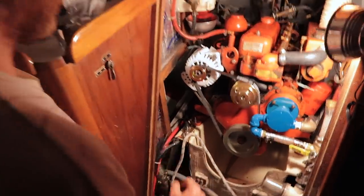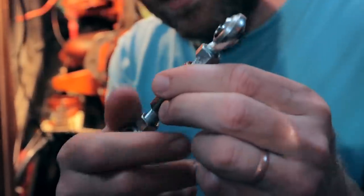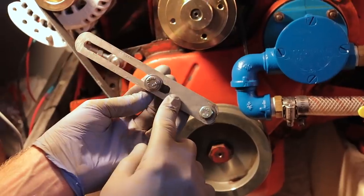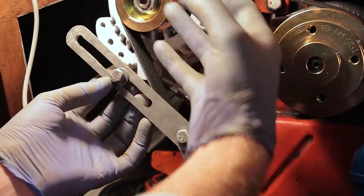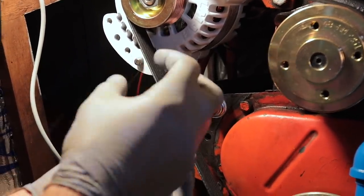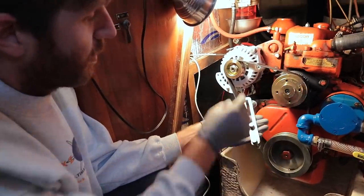Is that bracket gonna work? We're gonna use it for now, and then I'm gonna get a thing called a Heim connector, which actually works like a turnbuckle, where you can make it longer or shorter, so we can put tension onto the alternator and then thread these bolts down tight and lock it. This is the old-style alternator bracket. You could tension by pushing out the alternator and cranking this down, but it would invariably slip in a little bit and you'd need someone to help push against the alternator. Having this Heim connector is really cool — just one-handed adjustments to the belt tension — and it stays there. This was maybe a little flimsy for the much larger alternator as well.